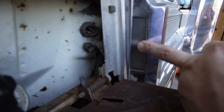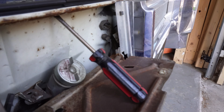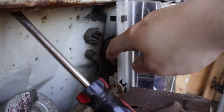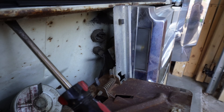I'm actually going to be replacing these bulbs with some new ones, so I'm going to go ahead and pop the whole assembly out. Working in here inside this spring-loaded license plate is so much fun. There's just a little tiny connector down in here. It's just got a little tab on it, you just pop it off. All this stuff's just so old.